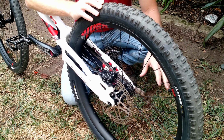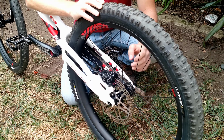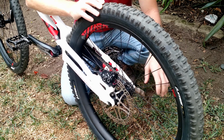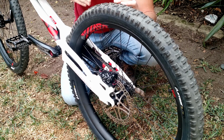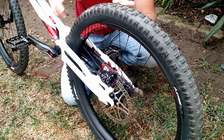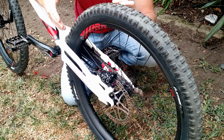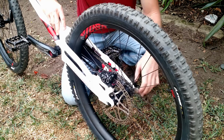Anyway, this was most of my headaches. But once I finally got the right hub, and I finally got the brakes spaced, and I finally got the chain line lined up, everything fit, and it was wonderful. And actually, I think the wheel has a little bit of custom dishing on it too, to get it centered in the yoke, because when it was built properly dished, it was a little too far over, so I had to give it a little bit of a custom dish to put it right in the center. And it's right in the center now.